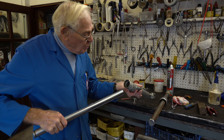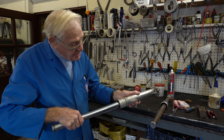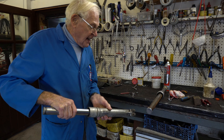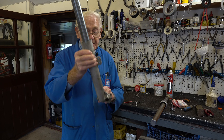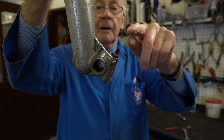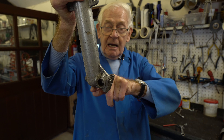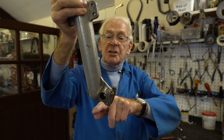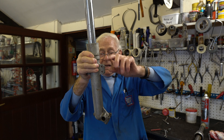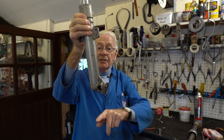Then you have the damper mechanism inside — no bushes, straight into the aluminium — so lovely, perfect movement, and the forks work properly. Miller did this at Bultaco too, because if you look at that Enfield, you've got the spindle in front of the fork. Having the spindle there makes the forks ever so much longer. By moving it back, you get better trail and more movement for the length of the fork. You don't want it sticking down here increasing the fork length.